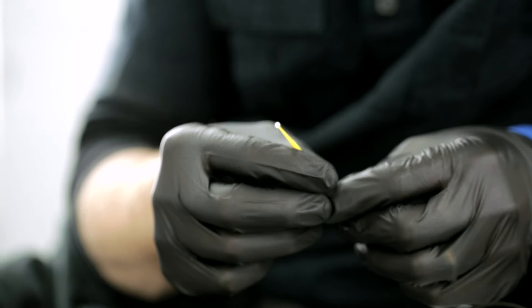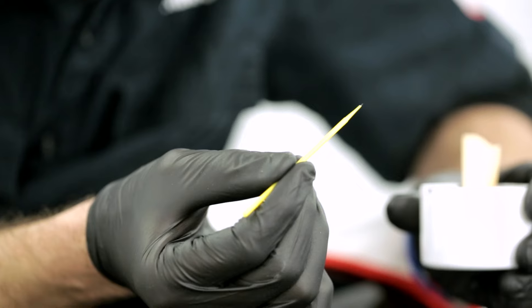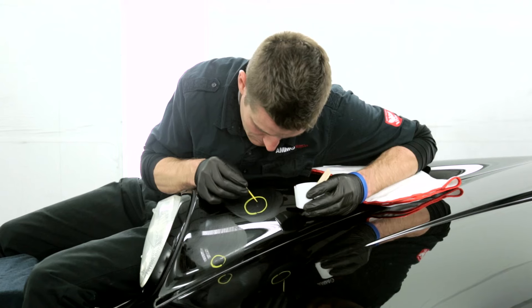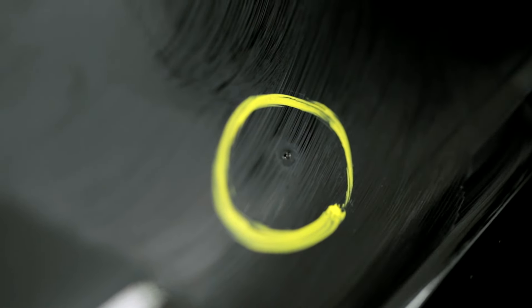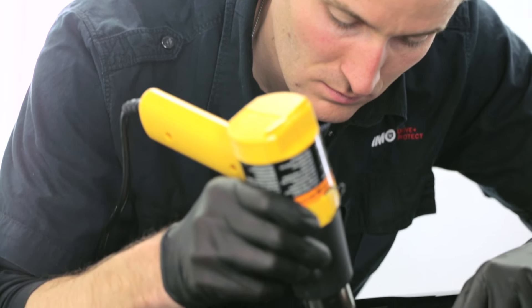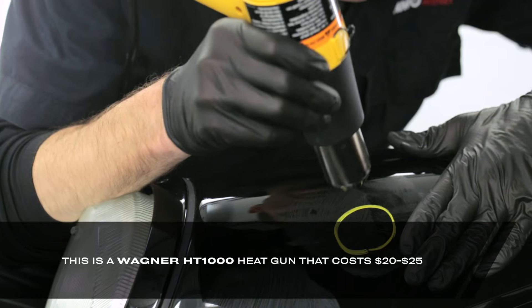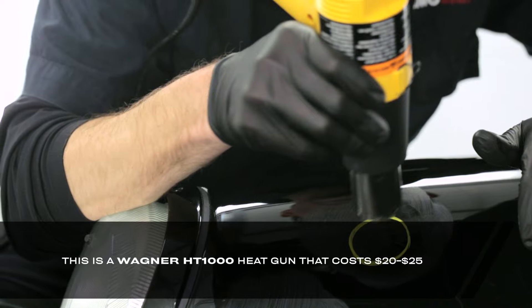To apply this new mixture of paint and clear, I remove the fibers from the touch-up stick so that it's bare plastic. You can use a razor blade or simply bite off the end. Next, dip the touch-up stick into the paint so that there's a small collection at the very tip. Your goal is to allow the paint to flow into the chip and to fill up the cavity slowly. The most common misconception is that a painting motion is needed — it's best to actually dab and push the paint around to help it settle into the chip. To speed up the drying process, use a heat gun on low for two to three minutes. Keep touching the panel to make sure it doesn't get too hot. As the touch-up dries, it will shrink, so additional layers of paint will most likely be needed. This will take time, a steady hand, and a good deal of patience.